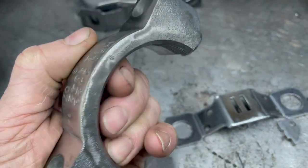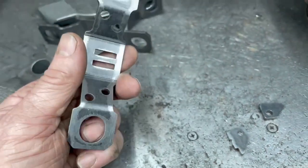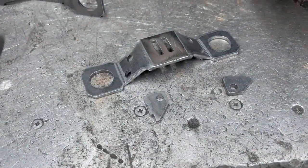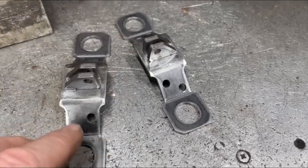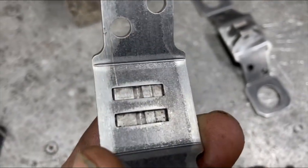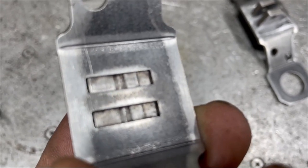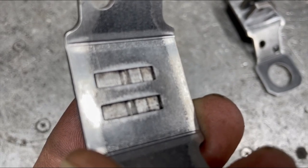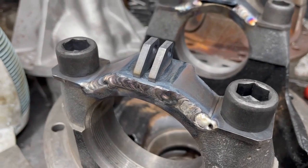We have cut that little tab off and cleaned up the carrier cap. We've ground it and machined it to fit our special CNC-cut Domex 700MC. These two little tabs are going to get welded into there, which allows us to fit the old-fashioned, properly strong locking tab. These Domex conversions for the short nose — when we weld them in, we don't weld them down here; we weld from underneath, leaving a three-quarter of a millimetre gap with a little hole in the middle. We seam weld over there with the TIG, and it hardly has a raised lump because it's welding the edge — so it doesn't interfere with the top of the carrier cap. We don't have to grind the weld off, which would make it weaker. Some time later of fettling, we now have that all welded into place.